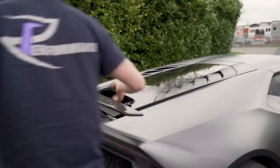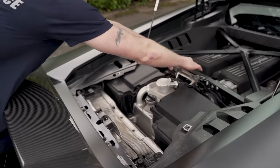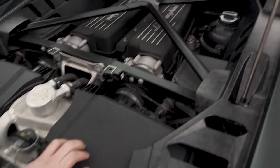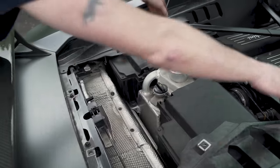We've got the service cover off because we've serviced it, but you'll essentially have a trim that sits over here covering all that area. You can see your coolant tank up in the top, two fuse boxes in these two air boxes, your exhaust, and he's got the forged carbon trim — very nice. There's your oil tank on a Lamborghini. It has a conventional dipstick, whereas on the R8 it's electronic — it doesn't have a dipstick. So this is more like a facelift Gen 1 R8 in that respect. The Huracan is all done via dipstick, which is probably preferable — much easier to control.